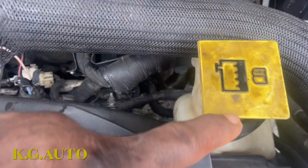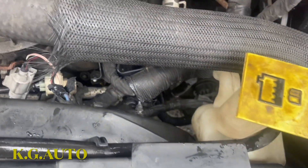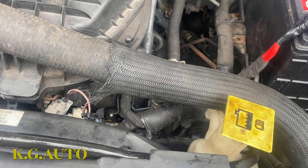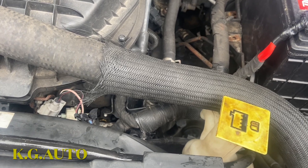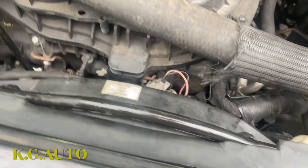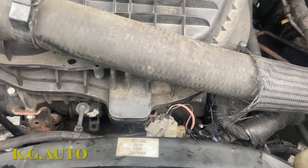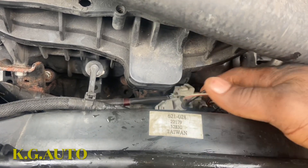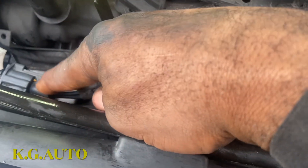This piece right here — you need to take out these clips. There's a pin here; you have to push this pin right there, push it in — that's how you get that piece out. Once you do that, don't forget to put the reservoir back. Everything looks pretty nice now. Go ahead and connect the battery and restart the car. Make sure you connect all those connectors for the fan so that the car won't overheat.